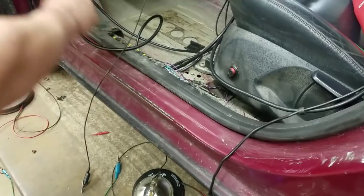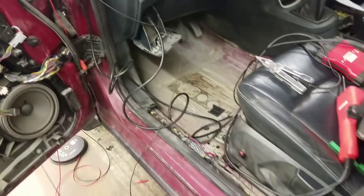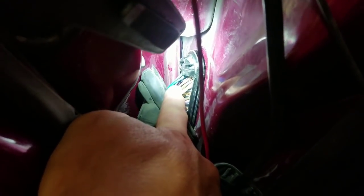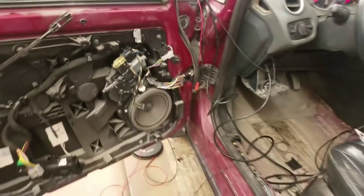This particular circuit is loaded right here — you can see it travels through this harness through the door. Doing a visual inspection, you'll see the pin right there is pulled out — you can see me move it around.